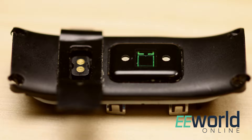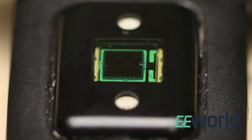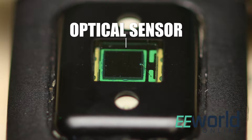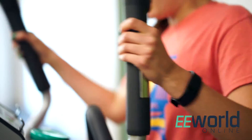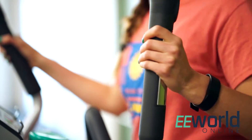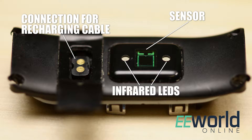So exactly what are we looking at in this close-up, Lee? Well, what you see here is both a sensor and a couple of dots. The dots are infrared LEDs. The two prongs above the sensor assembly comprise the connection for the recharging cable. The sensor is an optical sensor that detects light from the LEDs reflecting from your skin. The optical sensor and LEDs collectively make up an optical heart rate sensor that works via pulse oximetry — a measurement technique that takes advantage of the fact that oxygenated and deoxygenated hemoglobin have different optical properties. With every heartbeat, there's a spike in arterial oxygenated blood detected as a change in the absorbance or reflectance of LED light, and the optical sensor measures the amount of LED light reflecting from the blood under your skin. The reflectance is a bit different during a heartbeat, and the sensor detects this periodic signal from which the heart rate is extracted.